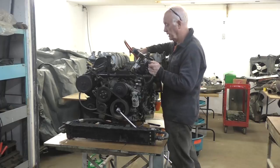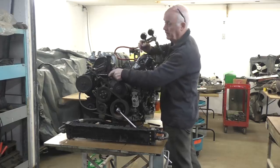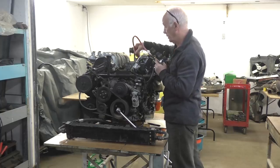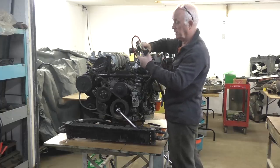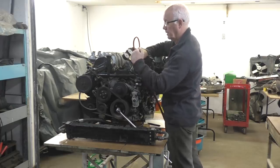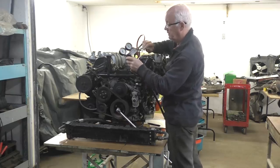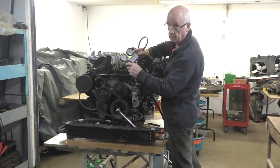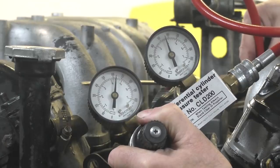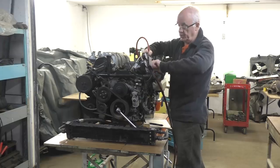At the moment I'm connecting up to cylinder 3B. Each bank, this one's called B, this one's called A, and then it's 1, 2, 3, 4, 5, 6 going on each side. So at the moment I'm in 3B, so this one's on top dead center compression, so I can show you now as I put pressure in the cylinder, you do it on here, and you can see on the gauge that the cylinder is holding fairly good pressure. Now I'm letting the pressure down off this,